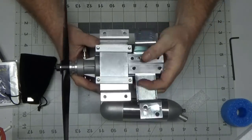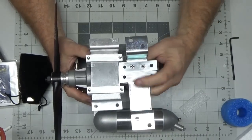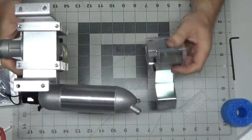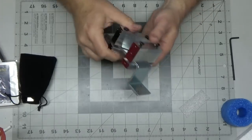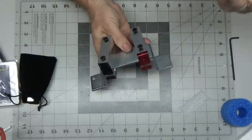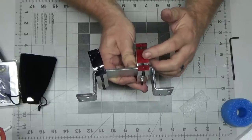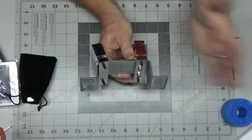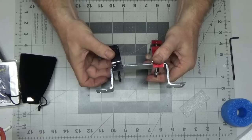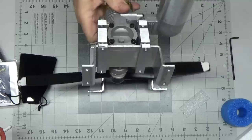This new stand is considerably wider in one direction but narrower front-to-back, and has offset holes for the larger hardware included. One interesting thing: they're painted — there's a black side and a red side. The black side is the stationary side you want to keep fixed, and the red side is your movable side. So when you put your engine in, all you have to do is loosen the red side and put it up in there.